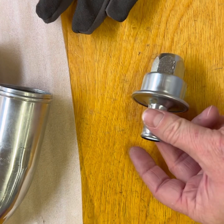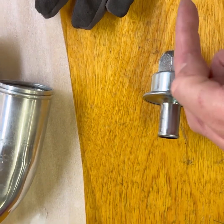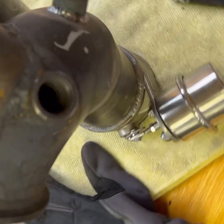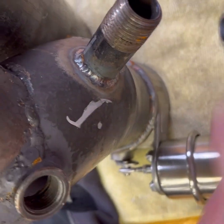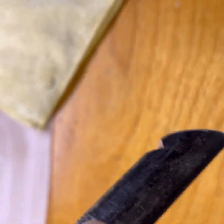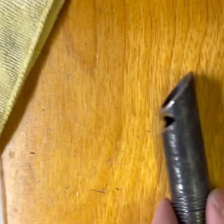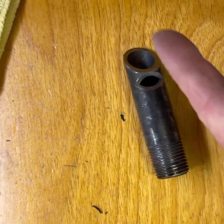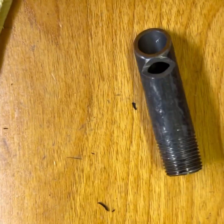From the separator it goes to this guy, which is a check valve — it only allows pressure flow this way. And what I'm doing is an old hot rod trick where I welded in a venturi, which is what this is. You mount it like this in your exhaust stream, the exhaust comes and hits it, and it creates a little eddy in there that draws vacuum. Pretty freaking cool — you can see right there, that's what's going to be creating that vacuum.